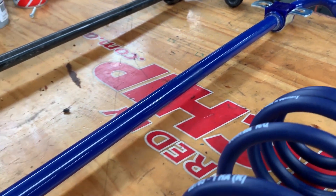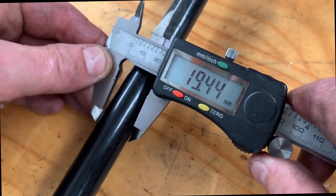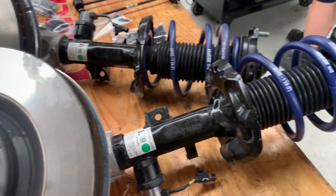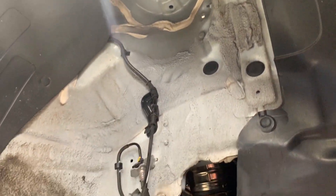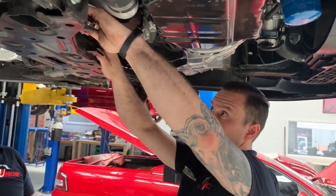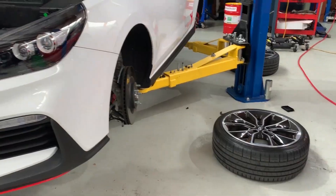I've got a set of verniers here. I'm going to show you the difference in diameter between the factory sway bars and the aftermarket Super Pro sway bars. What you can see on the bench here is that we've taken the front struts, shocks, and everything like that off as one entire assembly with the brakes still in place. It's easy to do this way — they're not very heavy and it gives us quick easy access to replace the front springs.